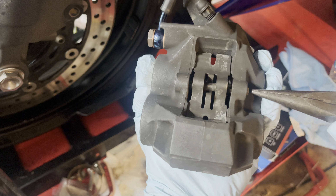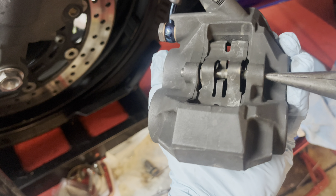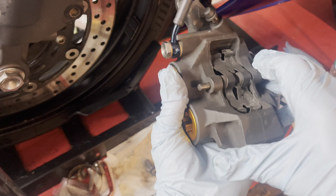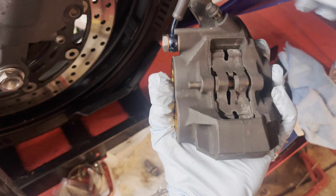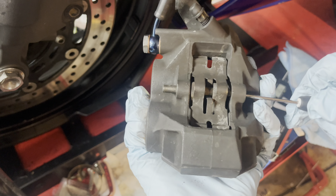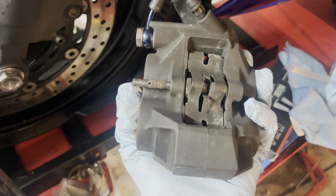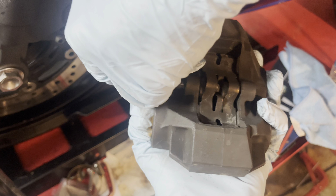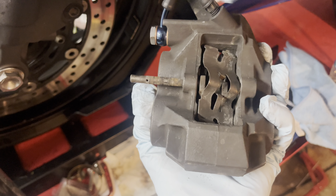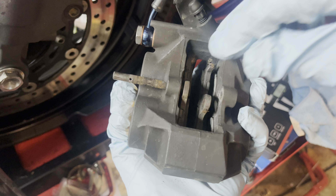Now this little center part, like I said, you're going to push either way in or out. I'm just going to push it this way for now. When this comes all the way out the pads will fall and so will this, so I'm going to try to hold on to everything. You may have to get something to push it through. As you can see this bracket is coming out now. So this will just literally go right back in there. Pads are coming out — there's one.